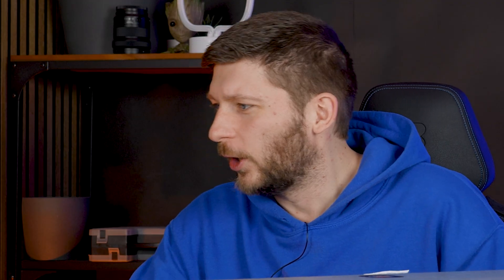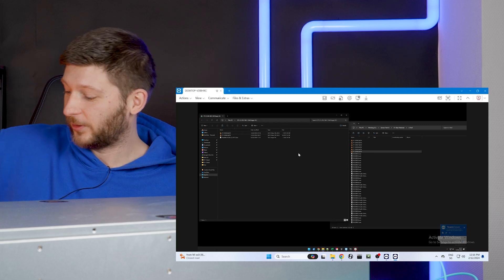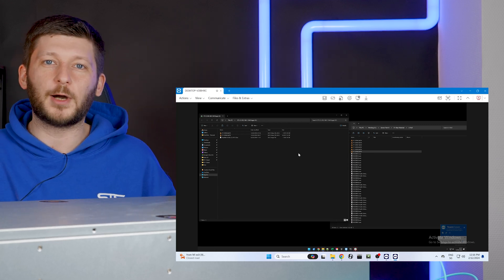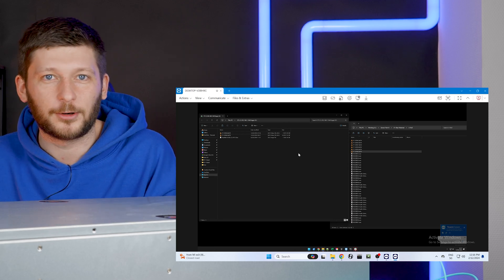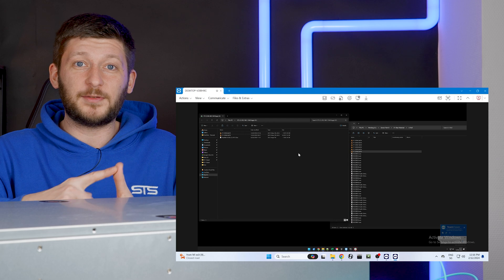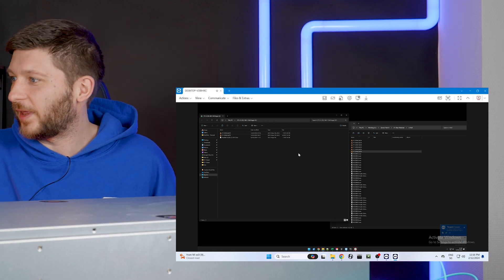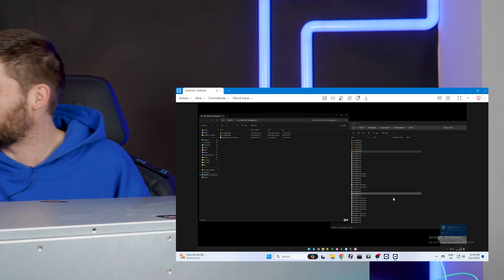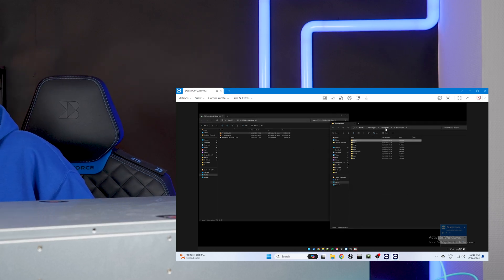We still have two cables in the server. There is another RJ45 cable in there, but that one goes into the IPMI system of the motherboard — that's a separate thing, like a separate PC — so that I can still access the whole ASUS control panel on another desktop. The main network connection now goes through this SFP+ cable. Reboot TrueNAS if you're switching your network card, and don't use two different network cards on the same network. Stuff we've learned.